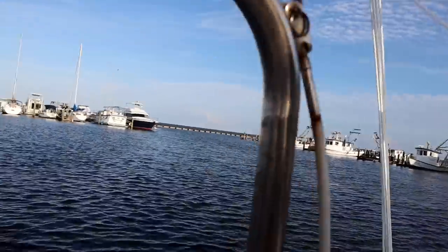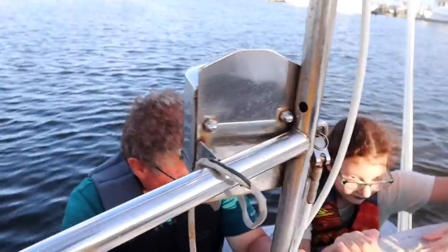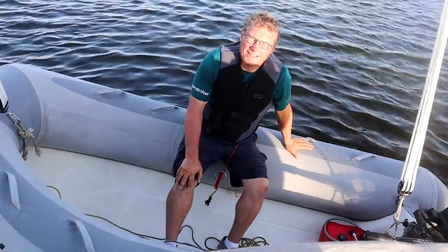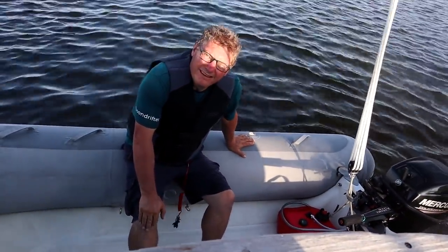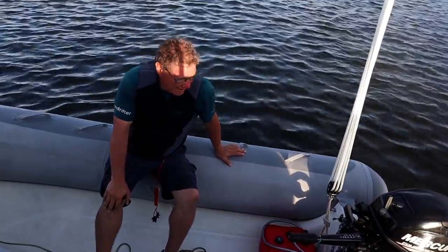All right, so I need the other piece of line. Can I get out now? Hold that. I don't want to pull in the precious water. Can you pull up here? Basically, let this run the gas out of the carburetor, let it run until it quits, and then there's nothing in the carburetor that can gum up the jets.